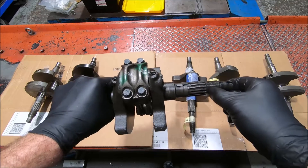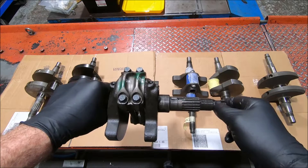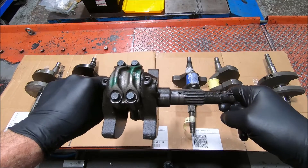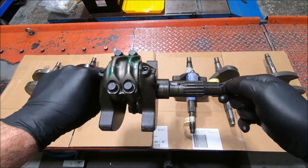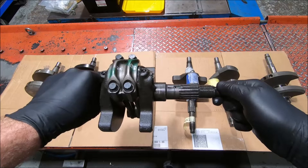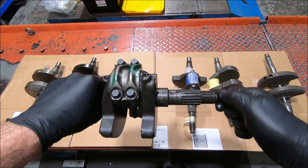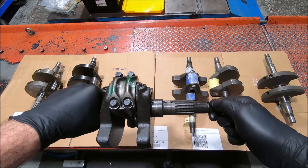It's got a great big nut on it. These nuts did come loose in some of the 1998, 1999, 2000 model engines. The torque spec was originally 190Nm, then it went to 270Nm, and some of the late model stuff it's 330Nm. Always Loctite them. The three-phase alternator started in 1998 for two-valve engines, except the ST2. The small block was redesigned for 1998 - 600 and 750 - going to three-phase, as did the 900 Supersport and Monster engines for 1998 model year. 1999 model year was when the water-cooled engines went to three-phase alternators: ST2, 748, and 996.